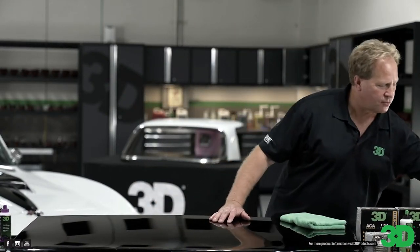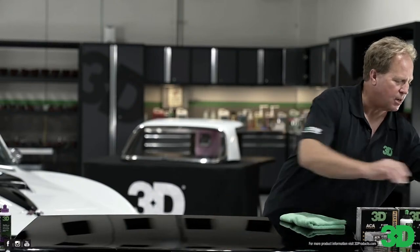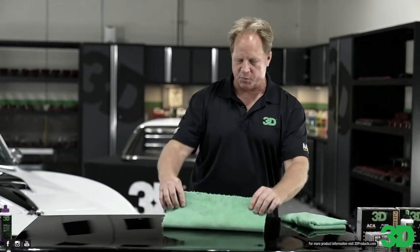No self-respecting technician in a body shop would sand down a 2020 Honda they just painted and then try to pull all the sanding marks out with the DA. Could it be done? Sure, it would take a long time. And in the body shop world, they don't spend that kind of time. They grab a wool pad on a rotary and go to town on it. So keep that in mind. When we say it takes down a P1000, that's in the context of a wool pad on a rotary buffer, and it should be someone that knows what they're doing.